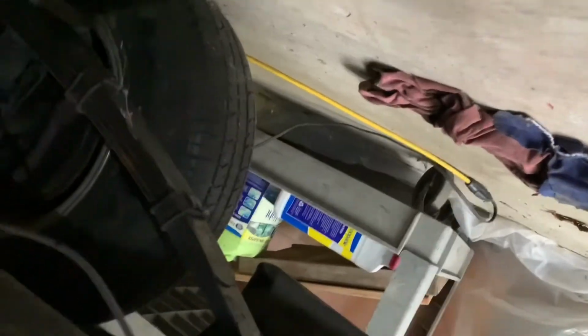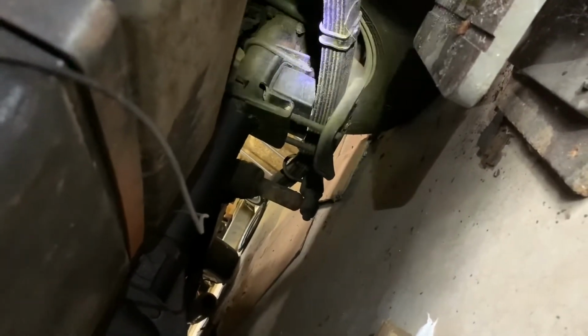I could take the time to jack it up, but it's chilly. This thing does have, I don't know if you can see them from here, air shocks on it. It's got lifting blocks between the rear end and the spring. So I don't know if those springs are original. I just don't know. And I don't see any numbers on that rear end at all. So I'm going to have to get under there further. I also need to measure it from one side to the other just to get some more information.